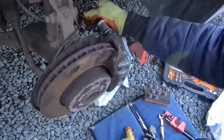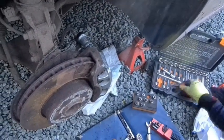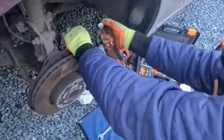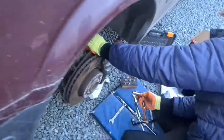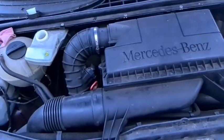It's good. And there they are moving. Now they're going to be a little bit sloppy because you haven't put the foot on the brakes yet, which will then engage the pistons. So if we just have a quick look, Andrew's just going to undo the bleed nipple, just a quarter of a turn. I'll go inside, put my foot on the brake, or are we going to do the other side first? Do that side first, yeah? Do one at a time.